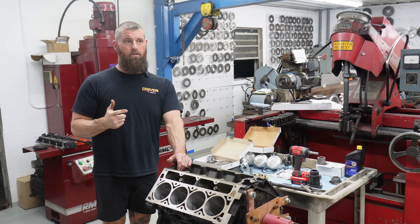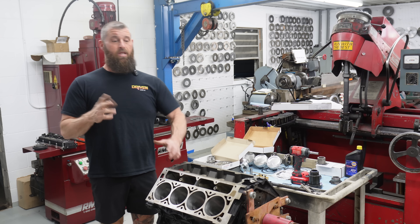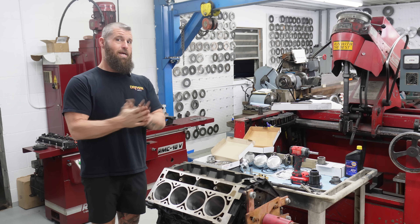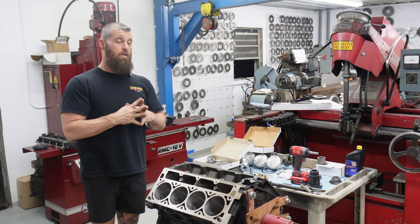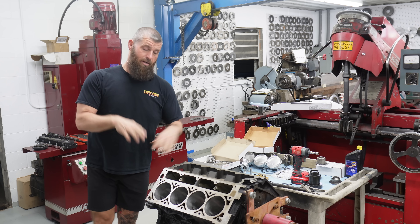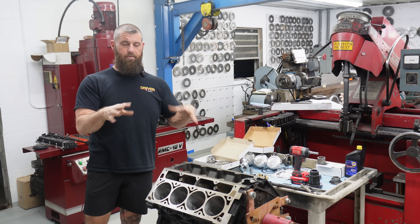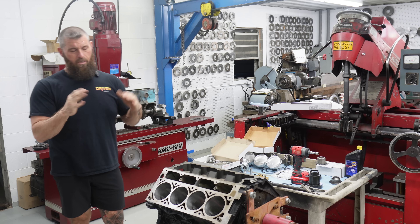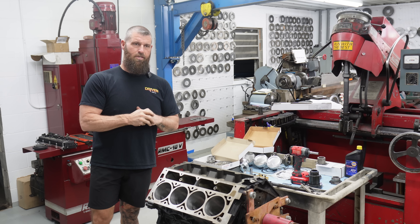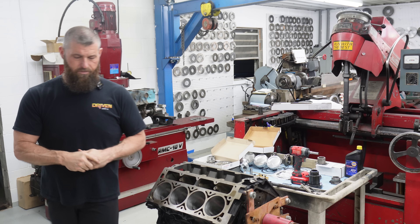We pulled an SA Gear set - we had to order some in - and I've done some preliminary checking this morning. I'm going to bring you in here and we're just going to do a side-by-side comparison and go over it. When we finish that, I'll let this be a video just about these timing sets, and then we're going to get into this engine, degree the cam, and look at some valve motion and piston and valve location stuff with the cutaway head.